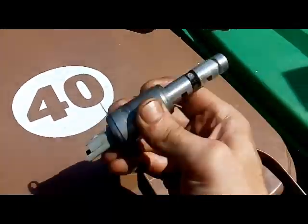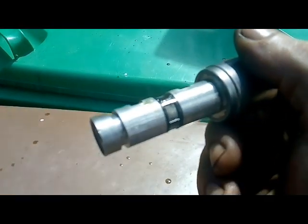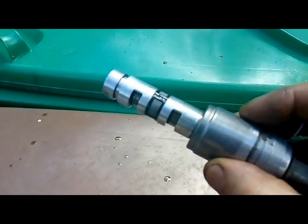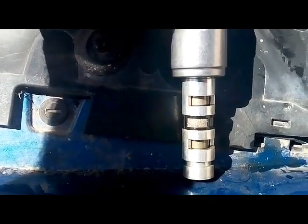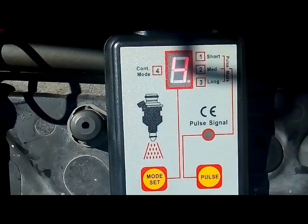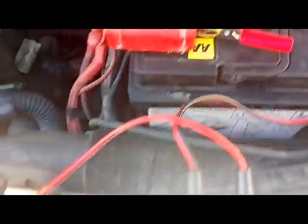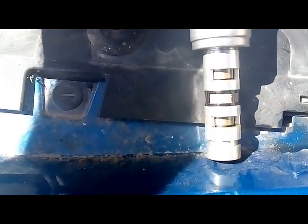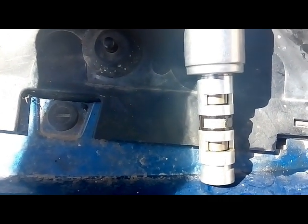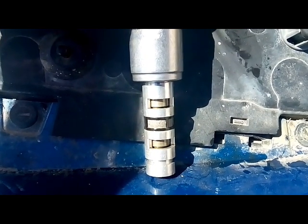If I shake it, the plunger's not moving inside — maybe it's got crap on the inside too. I'll try to activate it and get it cleaned out. I've got it set on continuous on the injector tester — it's actually an injector tester set on option four, which continuously pulses it on and off. I connected it to the battery using the injector tester. Because it's pulse-width modulated I thought I'd try it on this solenoid to see what it's like with the on/off, and it seems to be coping fine. I'm hoping that now I've cleaned out the gauze it'll run okay.